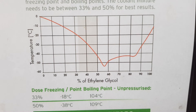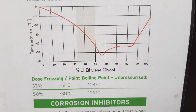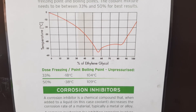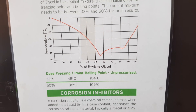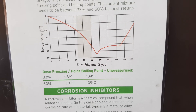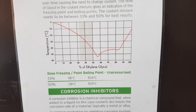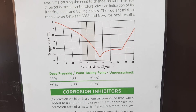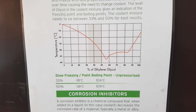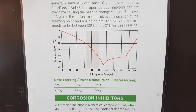We've got the right amount of ethylene glycol and basically the correct amount of inhibitors — they both match each other. If you've got the right amount of glycol, you've also got the right amount of corrosion inhibitors, and that's the most important thing. Yes, we're testing for glycol — cars in cold areas need it to stop the cooling system freezing — but the correct amount of glycol is also the correct amount of inhibitors.